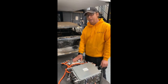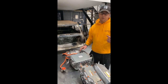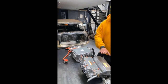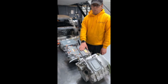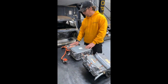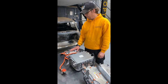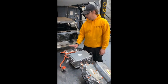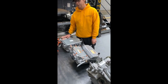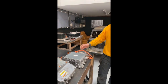Another component we're not sure if we're actually going to use is the heater. In the Mini as standard, you've got a heater that uses coolant pumped around the engine through the heater matrix in the passenger area to create warm air. Obviously with an EV conversion the temperatures are much lower, so you won't get warm air from the motor cooling system. The high-voltage heater heats a separate coolant circuit plumbed into the heater matrix to provide instant heat. We'll try it without first and see if we need to fit it.